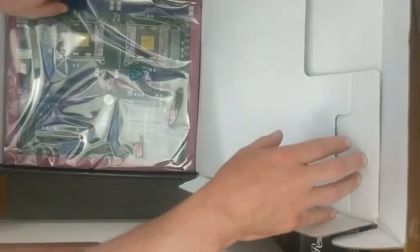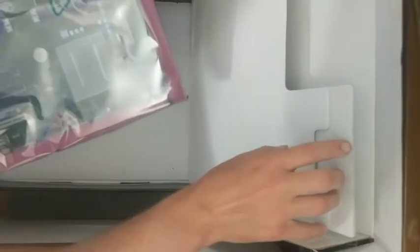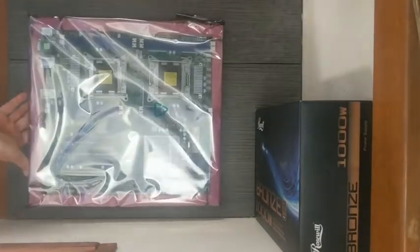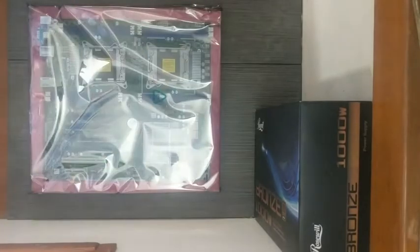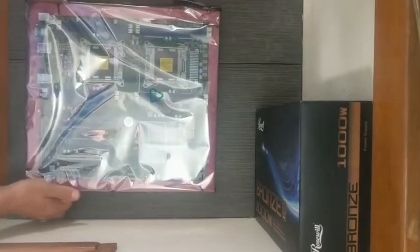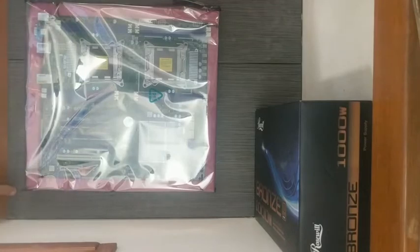Now, when you're dealing with electronics, the standard warnings apply for static electricity, i.e. it's not good. You have no need for the little charges to go jumping and frying up your whole works. Best way to handle that is with a conductive bracelet around your wrist, tied to something grounding on the board. We will not be having that. We will have to equalize the static charge between the CPU, my hand, and the board very carefully.